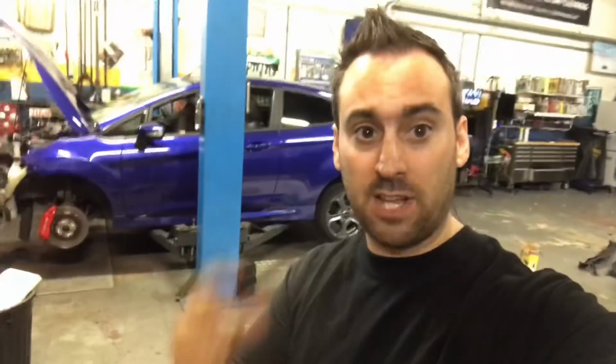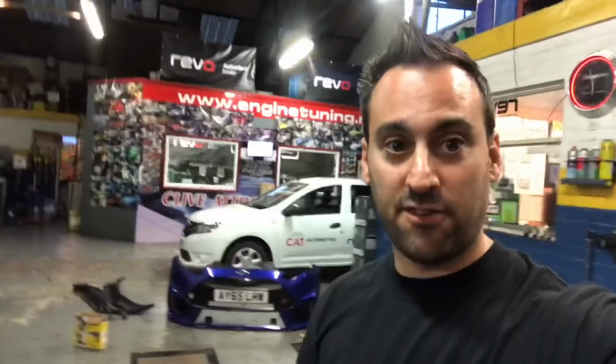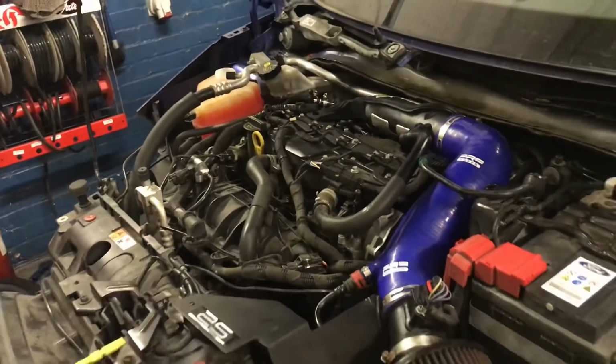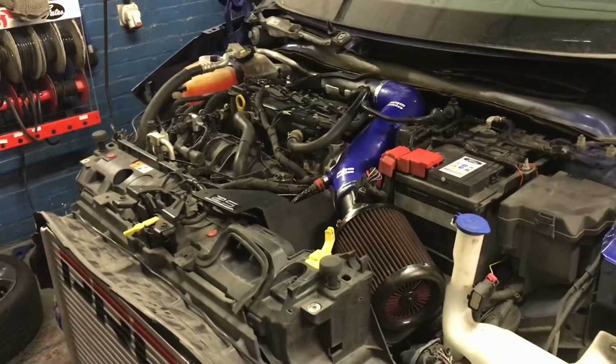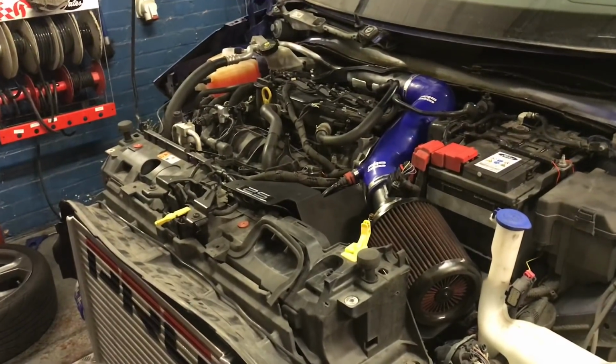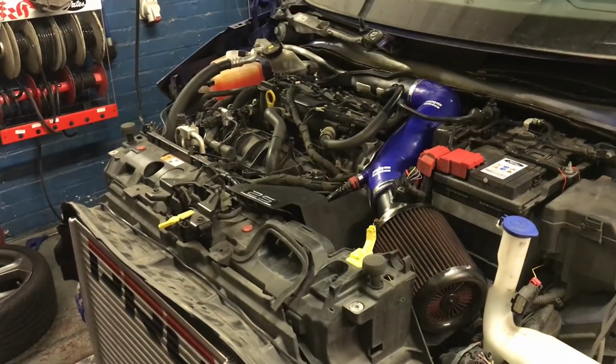So obviously what we're trying to do now is just basically get oil pressure with the coil packs completely off, or the coil pack clips all completely off. We're just getting oil pressure. Yeah, ready to start firing up. Start up with coil packs on. We'll check for leaks at the moment. It's all good. Fired up pretty nicely, fairly quick there, so good sign so far.